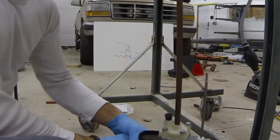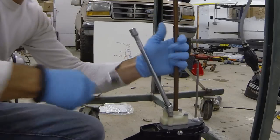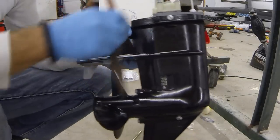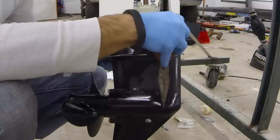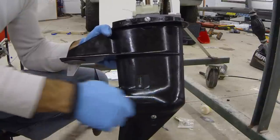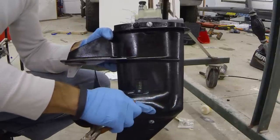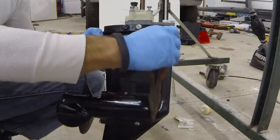To disassemble this, we're going to break free our four bolts around our water pump housing. To give a little background: this is our shift rod that goes down to a little cam. The cam is kind of like the end of needle nose pliers. As you push the shift rod down, it slides a rod connected to the drive train — either forward, back, or back even further. All the way forward is forward gear, the middle is neutral, and all the way back is reverse gear.